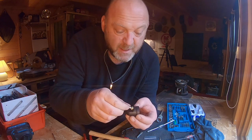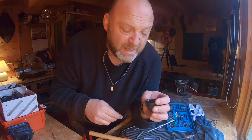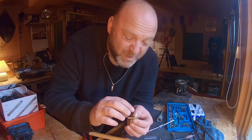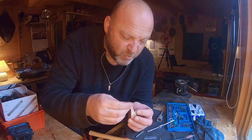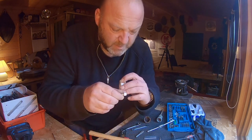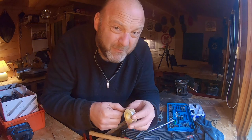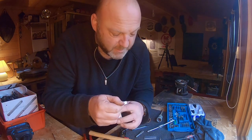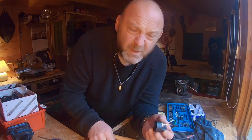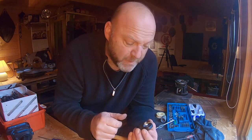Right, it's through. It's a little bit loose so I need to put some PTFE tape on it - that's going to tighten it up. I'll also put some silicone around there as well. Always forget which way PTFE tape goes on - basically as you're turning the thread, you want the tape to tighten up as well, wrapping this way as I'm turning that way. Right, all you pipe fitters out there, just look away!